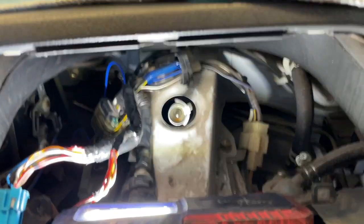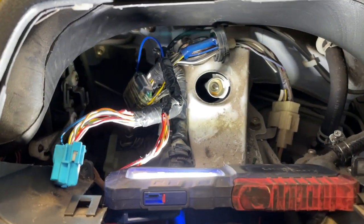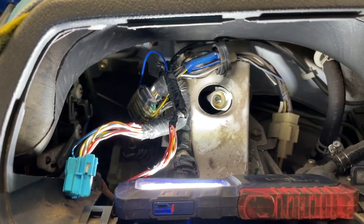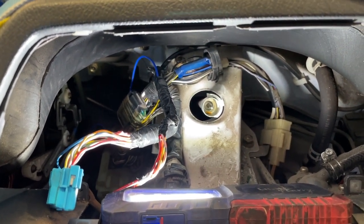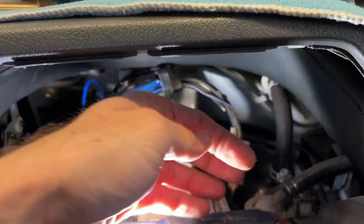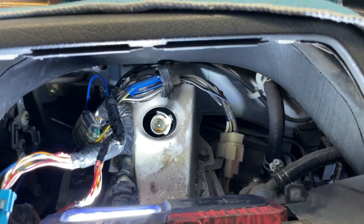To do that, first we're going to go underneath the truck and loosen up all the speedometer cable brackets, taking as much slop out of the cable length as we can. That way when we come back up to the truck it'll give us an extra inch and a half or two — just enough to plug it into the back of the speedometer.